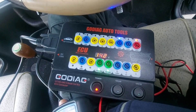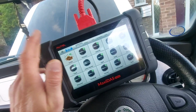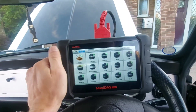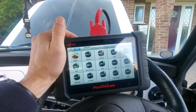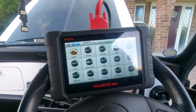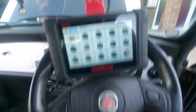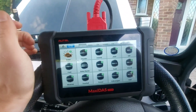I'm a bit stumped to be honest — there's still no communication. I don't know whether, because it's a 1999 and it's on the cusp of OBD — OBD sockets came out in 1998 and this is 1999, the first fuel injection system — I'm not sure if we're using the right computer for this car. There's either a fault on the CAN network, a fault on the communication connection between the OBD socket and the ECU, or this computer just can't connect to it.